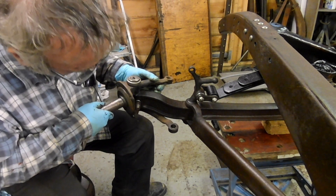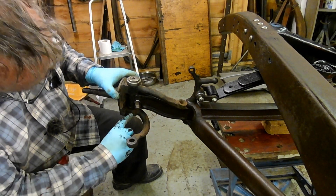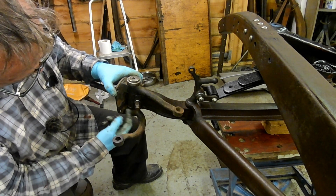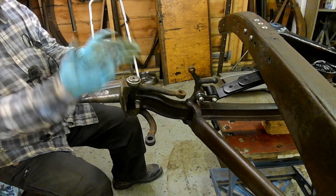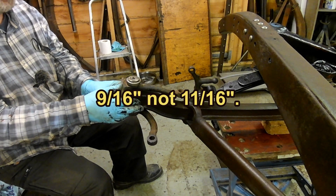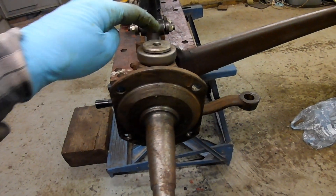That appears to be just touching there, and I could see marks on the axle where it has touched, so that's not very good. It might be that if the kingpin bushes were okay it wouldn't touch there, but there's only a very small gap which you can put shims in, and you put a felt washer in there just to stop any moisture getting into the bottom bearing. So just to clarify: there isn't a front and rear to these axles, and if you can't put the bolt in, just run a drill through — eleven-sixteenths or a reamer.